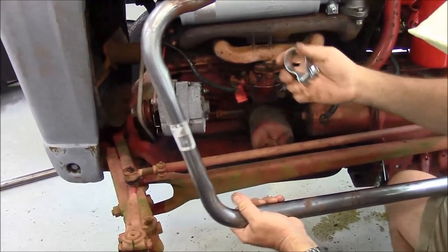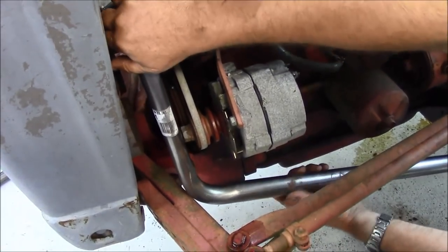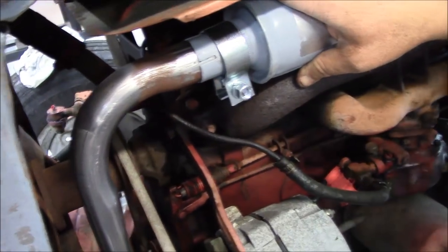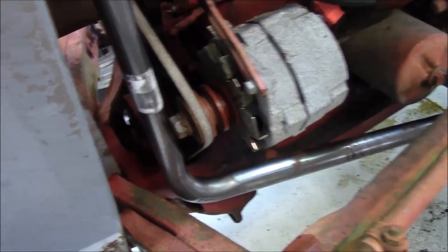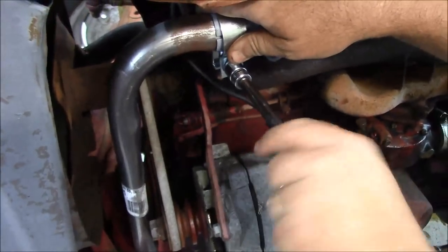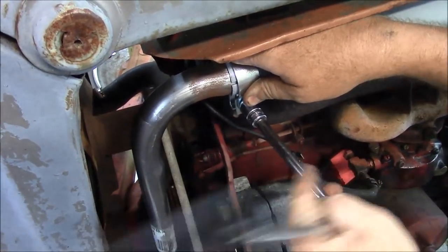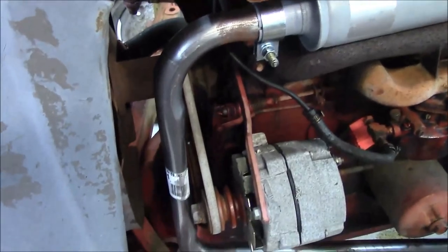The 2x4 took the beating instead of the muffler, and we've got the appropriate clamp. We're just going to put a little pressure on the clamp — not enough to prevent it from moving, more like enough to keep it from falling back off. Then we'll go on and put the rest of the parts on here. We've got the correct pipe and another clamp with a little more anti-seize on the threads in case he has to take it back off. This pipe is going to fish up in front of the alternator. We'll leave everything loose because it's going to need to get adjusted into place.